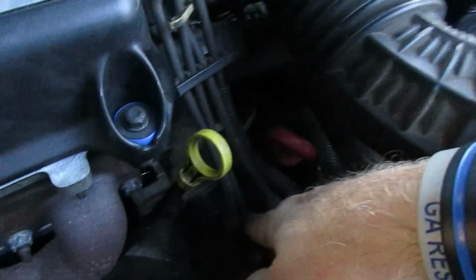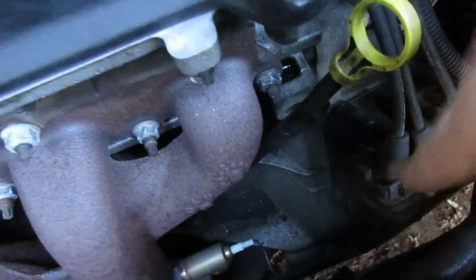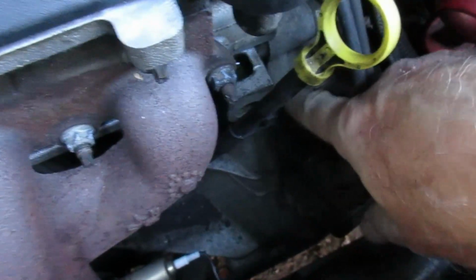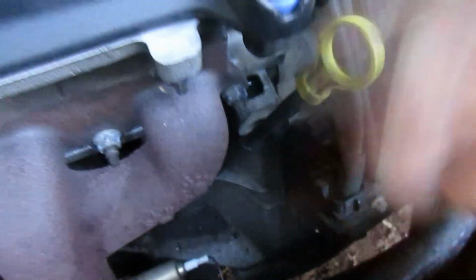I'm going to interject here as a voiceover. The actual problem was the crankshaft position sensor. When your crankshaft position sensor goes bad, it can stop the spark. I did end up replacing the spark plug wires and the coils and all that, which ended up not being necessary. I got a new crankshaft position sensor, the bolt got loose, which kept it from starting. And then I ended up having to replace the connector as well, because the connector was not making a connection to the crankshaft position sensor. Once I replaced both those things, the crankshaft position sensor worked well. The only other problem was the fuel pump was starting to go too, and you'll see that in my next video. Now back to the video.